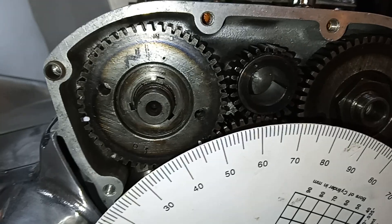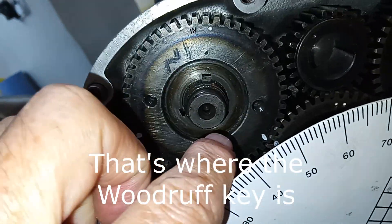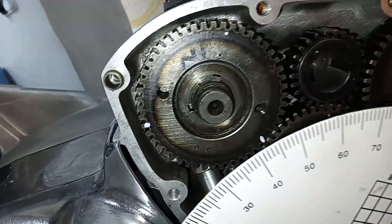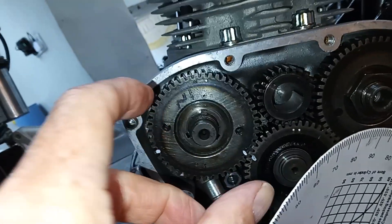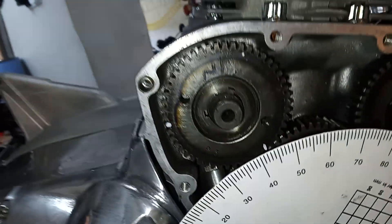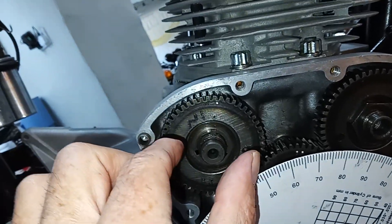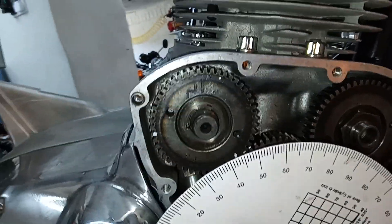The thing to remember is that there's the keyway. Basically the keyway will be moving to a new position. Because we're altering the timing and it's a third of a tooth different, it probably won't slot on perfectly — I might just have to rotate the engine slightly to get these two dots to line up. The whole point is moving the camshaft round very slightly to change the timing. I'll set up the puller and pull the pinion off.